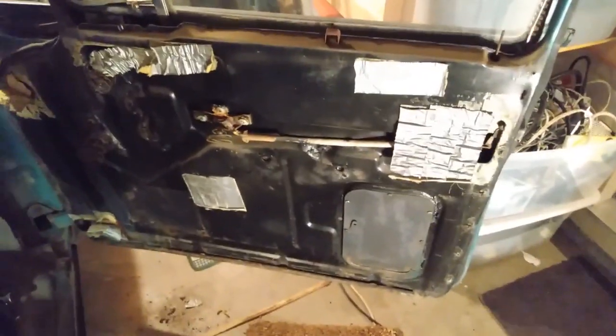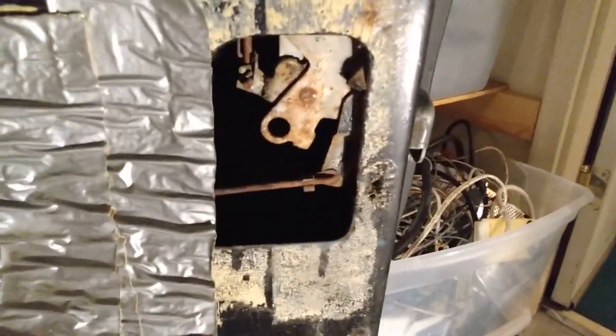I'm really wondering if this has ever been taken off. That piece came out — it was actually on here really good. The trim and all these staples are still attached. Let's see what's underneath here. Well, there's my answer — it's definitely been off before. I'm going to put metal tape on all these holes. Yeah, it's been off before. Now I'm going to play with the mechanism and the door lock — it probably just needs to be lubed because it's a little rusty in there. So I will silicone spray it and put it back together.